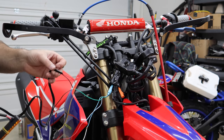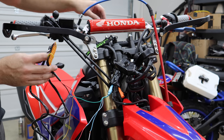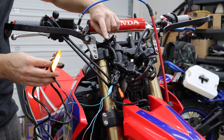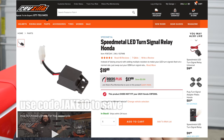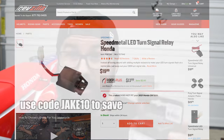So with that we know how to wire this thing up. I've temporarily twist-wired everything together — I just want to give a quick check to see if it works. The turn signal has something called a relay. If it's set up to work with incandescent or halogen bulbs and you switch to LEDs, they don't tend to work properly. That's fine because I happen to have, from Speed Metal via Revzilla, an LED turn signal relay. My discount code works with this brand. Let's pop this in — super simple — and see if it fixes it.